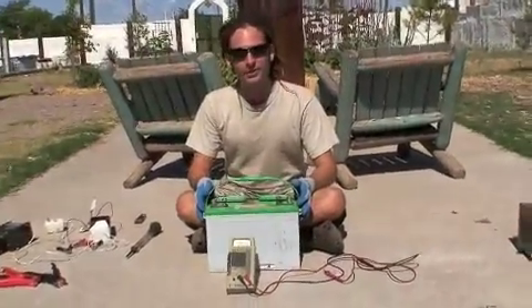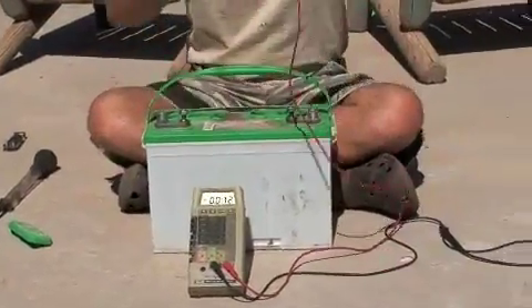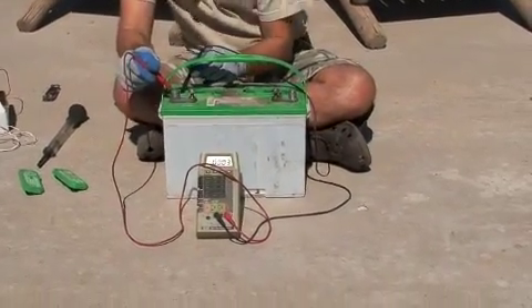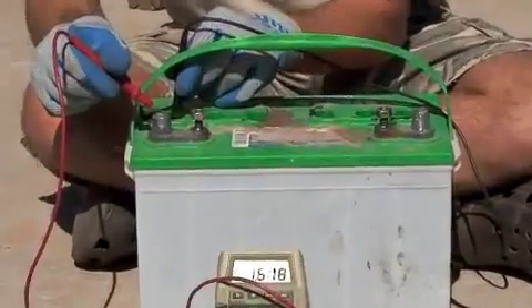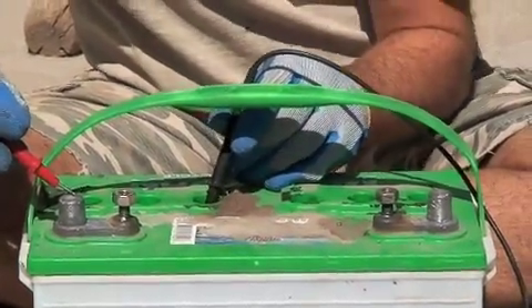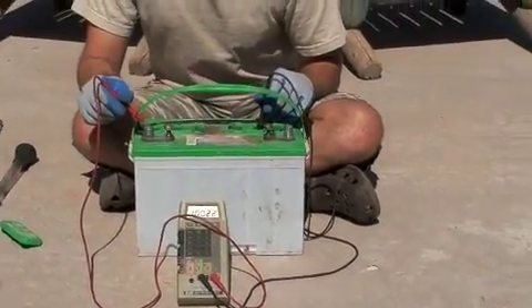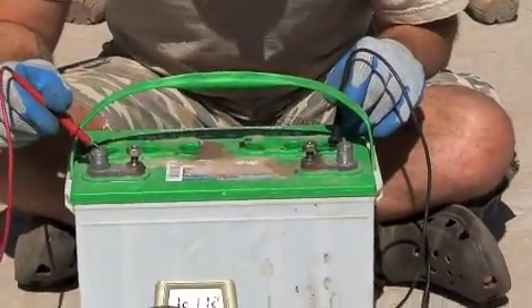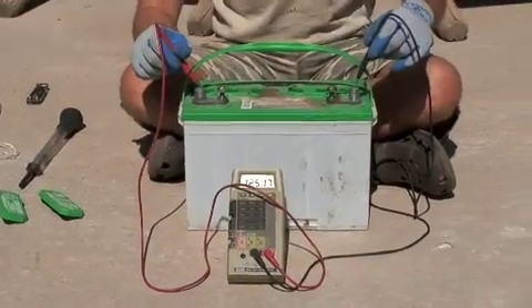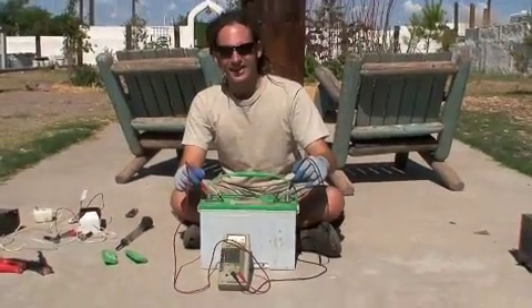Here's a trick I learned from a manual that's been really useful. I take my multimeter and pop the caps off the battery. Then I take the red positive lead and the negative lead of the multimeter and put them right into the acid — the negative is actually floating in the acid. Don't push it down so it touches the plates, that's not a good idea. The idea is to get voltage readings from each individual cell, and they should read somewhere around two volts each. It's also good, while you've got the caps off, to look inside each cell and see if there's any white stuff — that's sulfation, those are the sulfur crystals. Or if you see any dirt or debris in there, or one cell that reads completely off. You can test each cell individually and see how good the battery really is. Sometimes you get a single cell failure, and no matter how much you desulfate it, the battery will always read around 10 volts — too low and unusable.